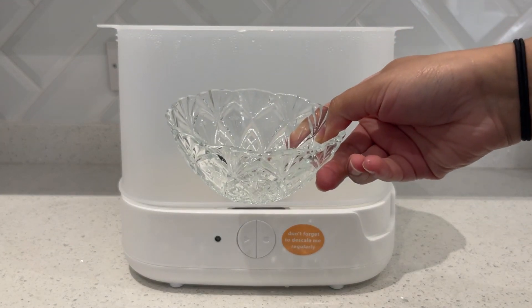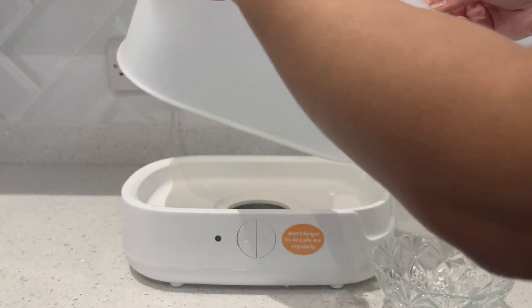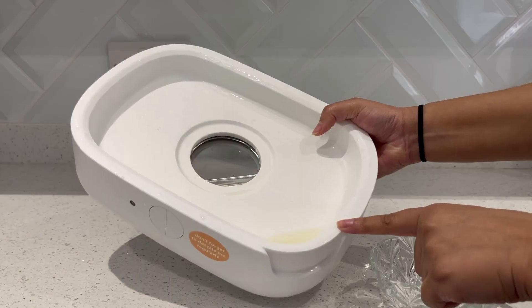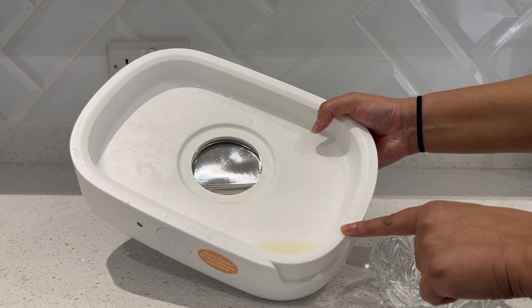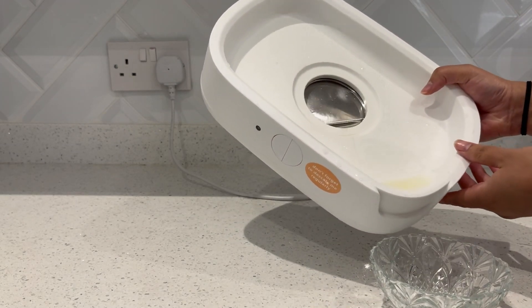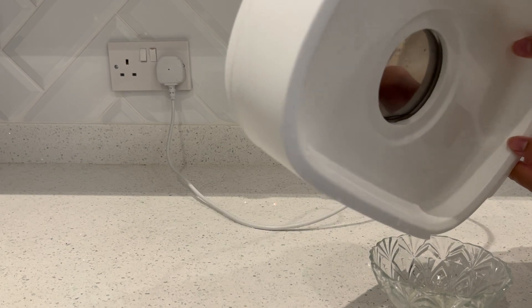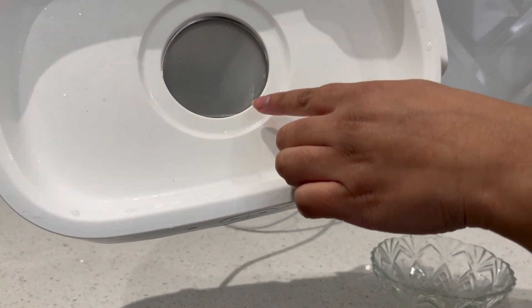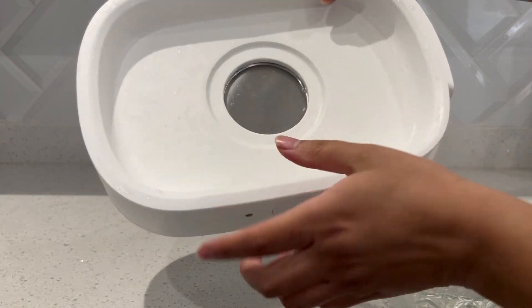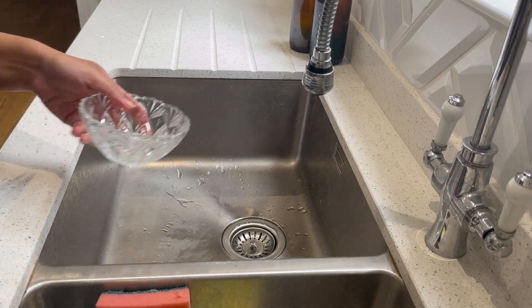Then in the morning I'm going to grab myself a little bowl, just enough to catch the vinegar, and I'm going to take the top off the machine and pour that vinegar into the bowl. As you can see, before I do it is quite yellow, and that's all that limescale buildup being taken off the plate. Once that vinegar is in the bowl you can see that the plate is now really really shiny again — it's much clearer than what it was. Then I'm going to take that to the sink and drain the vinegar.